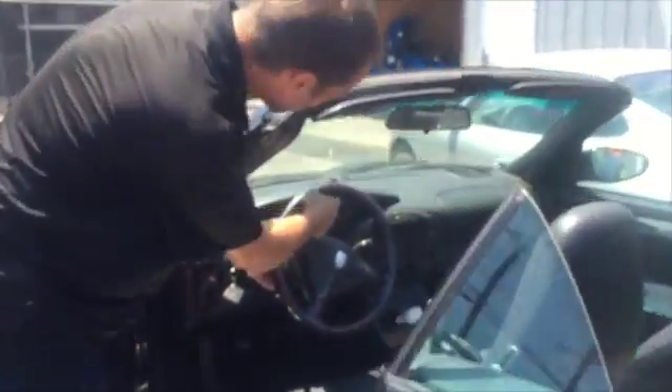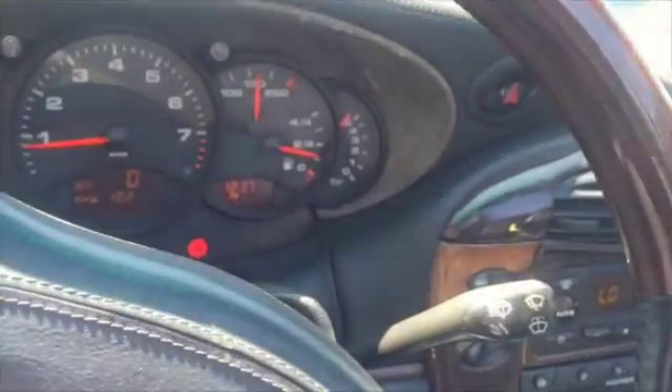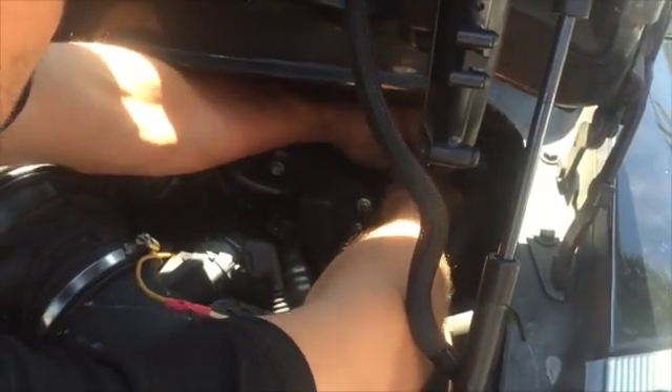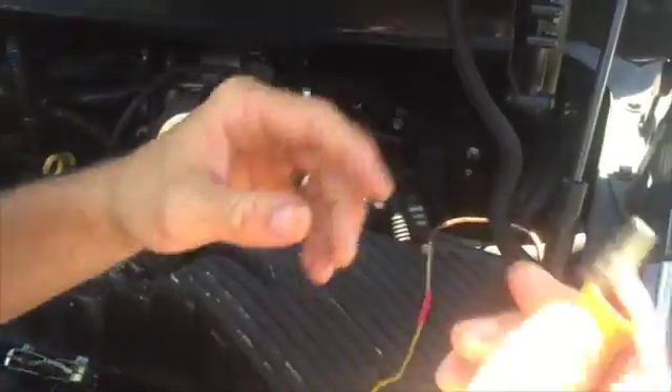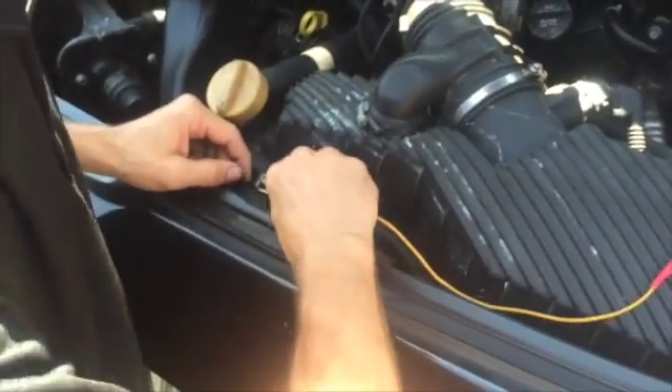As you can see, the wires are unplugged so it's reading full oil pressure because the wire's not grounded. I'll be taking the green-red wire, which is the oil pressure wire, and I'm going to plug it in from the other sending unit of the other car and ground both car to car so they can read.